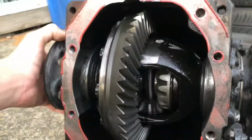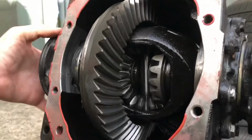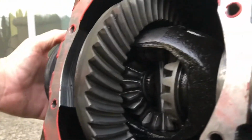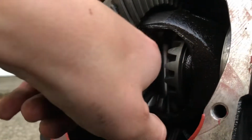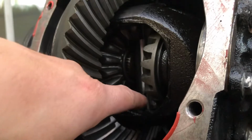Get welded. So I hit it with brake clean a whole bunch. You guys saw that. Torched it a whole bunch. I hope you guys saw some of that. And basically the thing that needs to be the cleanest are these gears here on the inside, because that's where you're going to be doing the welding. Right on that corner, this corner, that corner, and that corner.